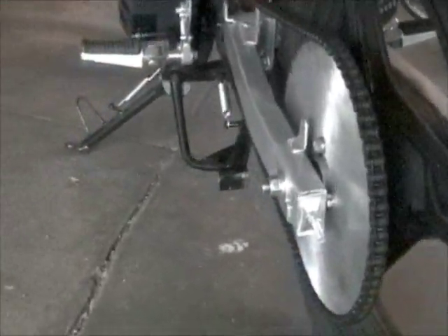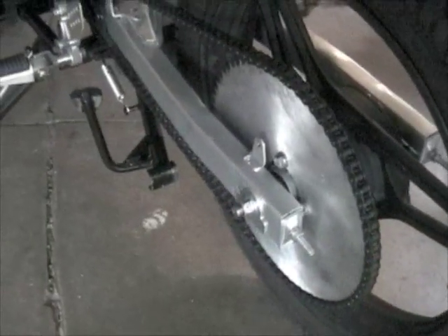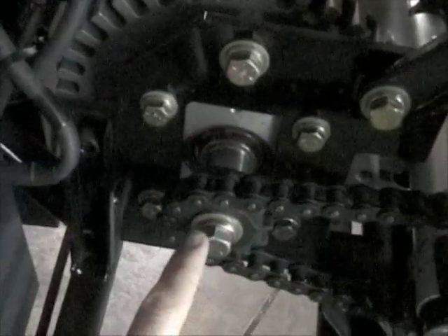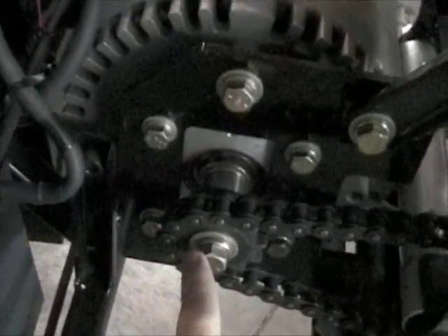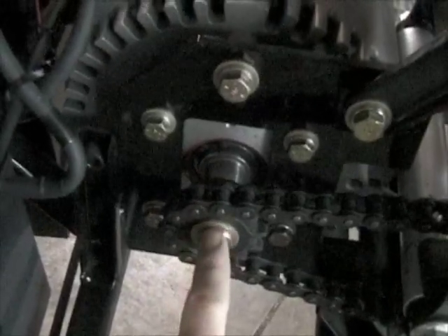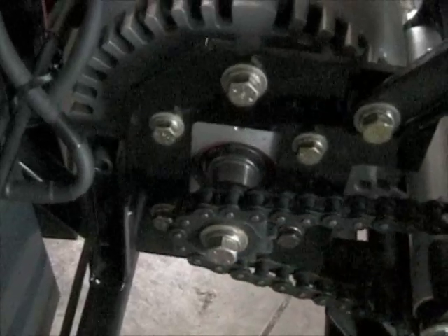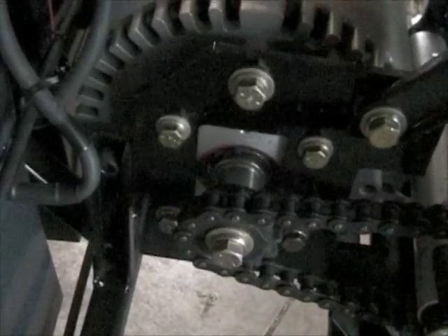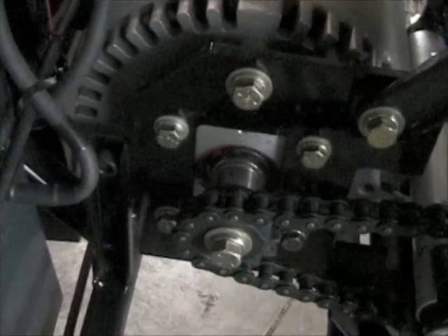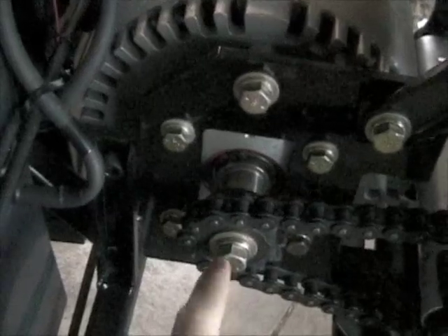This is my back sprocket — 72 teeth — and it was purchased custom; there's a link on the website. Here's the front side, and that's the motor pinion. Those are very cheap, and you can swap them out if you want to go different speeds. I have it geared right now to go 45 miles an hour, but this gear could be swapped out — you'd bring the rear wheel in a little bit to adjust chain tension — and then you could go 50 to 55 or whatever you want just by swapping to a bigger-toothed gear.